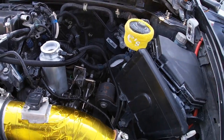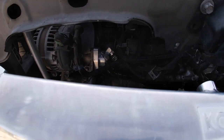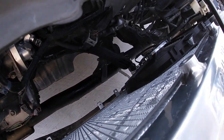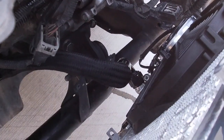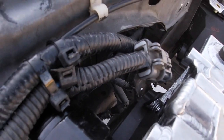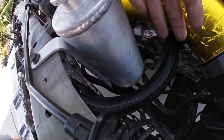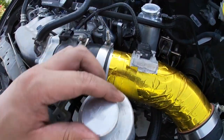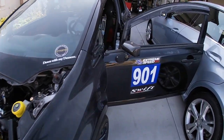A little bit more light out here so you can see everything going on. There's the K-Tuned thermostat right there. All the plumbing has been converted to dash-16 lines. Here's the upper hose going directly to the swirl pot, and here's the overflow tank right here. All right, let's try to start it — hopefully there are no leaks.